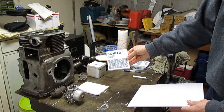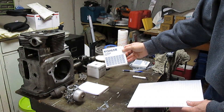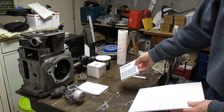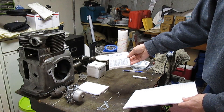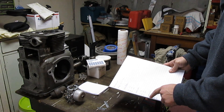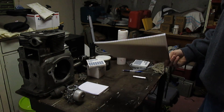So what did we do? We got a 30-over ring set and I end gapped these to the bore to factory spec. The top ring worked out to be 13, the middle ring is 14, and the bottom ring is 13. Not right on 10 but not above 15, so we'll have good wear and it shouldn't bind up. Once the motor gets hot we should have plenty of good clearance. So right now we're going to run with a 30-over set end gapped to 13 top, 14 middle, and 13 bottom.